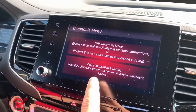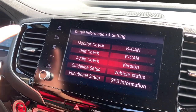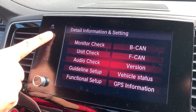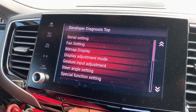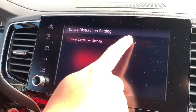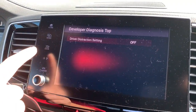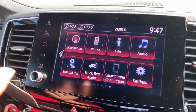And then you're going to select down here at the bottom — that's Detail Settings. Go ahead and click it, then you're going to hit Menu. Hold down the Menu button, then scroll down to Driver Distraction Setting and click that. Hit where it says On and shut it off. Then go back, back, and just keep hitting back to exit.